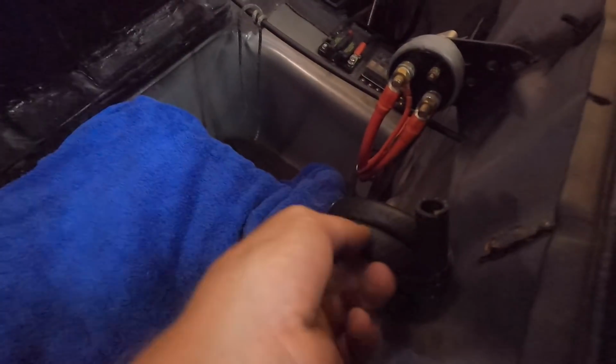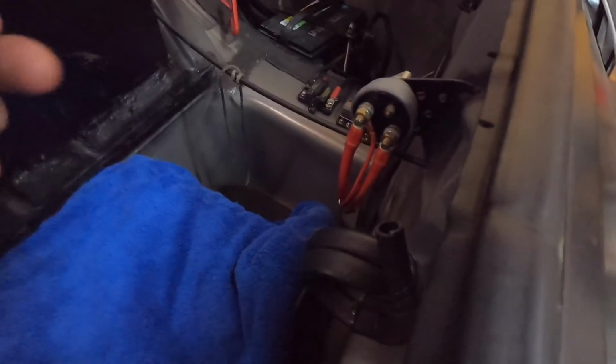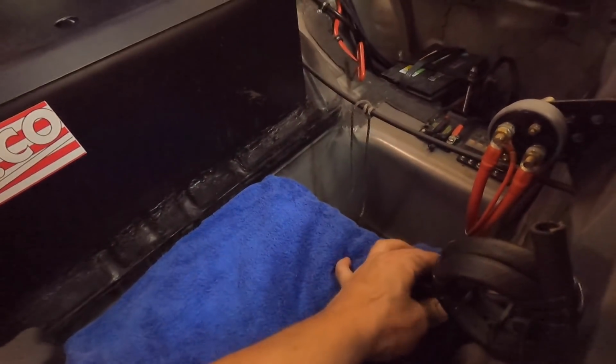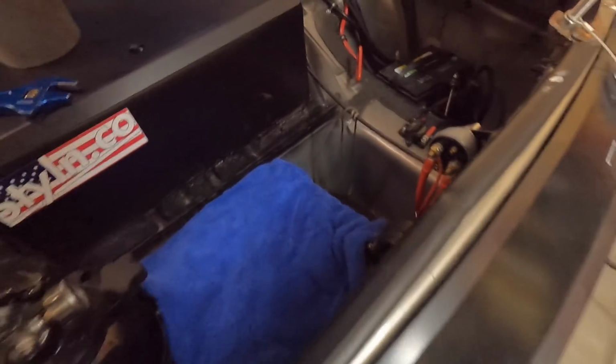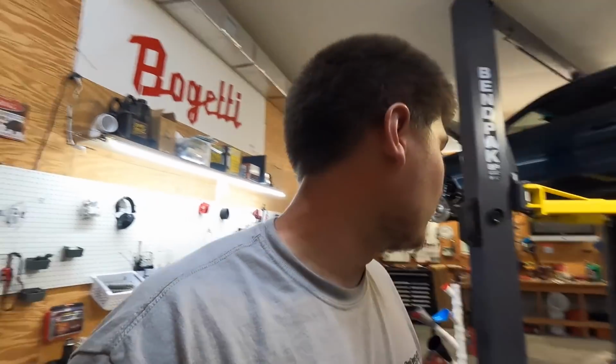This is my vent hose, and it really doesn't leak out of here. It was dry after that pass. You couldn't see any water out of here, and it would have to go backwards and then go like 3 loops. So it's pretty difficult to come out of here. So definitely not coming out the vent hose. I checked that, I triple checked that. So it's coming out of somewhere else. But I'm really thinking it's just condensation, so we'll see.